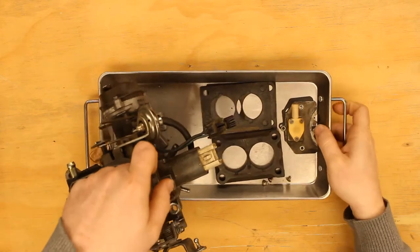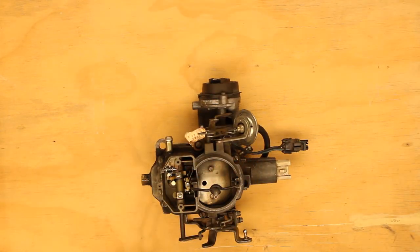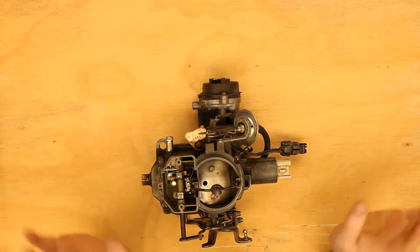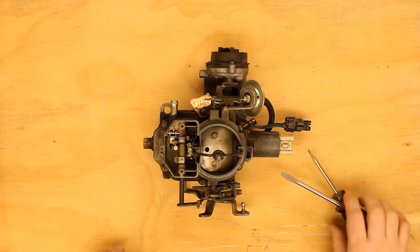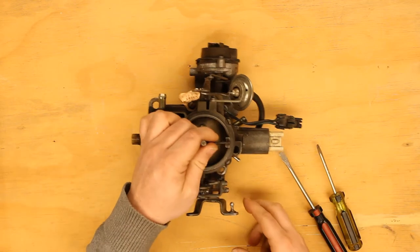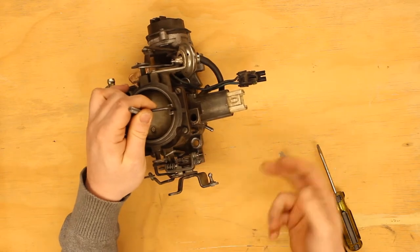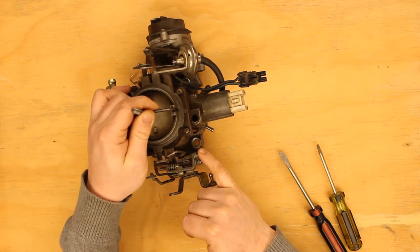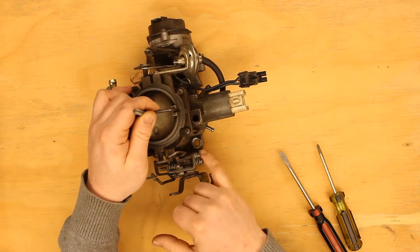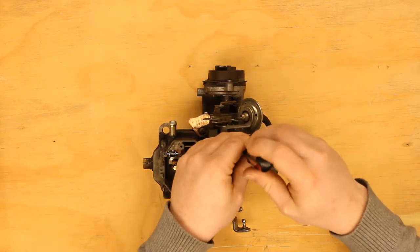All right, so the next day — this has spent a fair bit of time evaporating, and we are now ready to do the inspection. The first thing I'm noticing is I screwed up during the rebuild — I actually have my choke adjustment screw and my kick screws in the wrong spots. I'll deal with those later; that's not what my fault is, I guarantee you that.